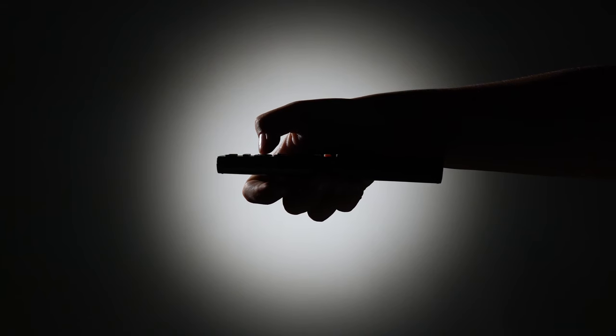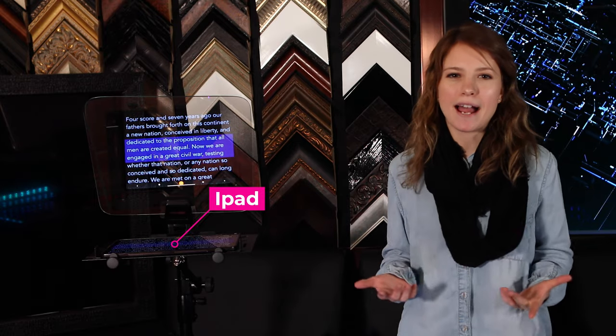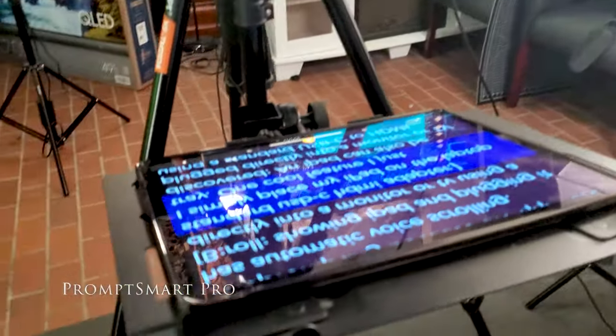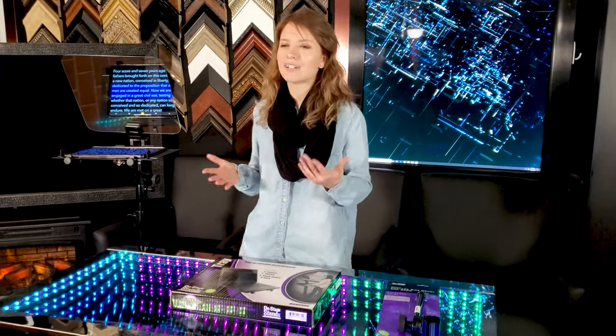Choosing your display: a Samsung TV, which has been mirror-flipped, makes a perfect display for a large-scale teleprompter. Simply press mute, 1, 8, 2, power to access the mirror mode from the hidden menu. We have another video dedicated just to flipping your screen — we'll post the link in the description below. I also like using an iPad for fast teleprompting because the app I use has automatic voice scrolling. One cool feature I just discovered: an iPad can also be plugged directly into a monitor or TV using a standard USB-C to HDMI adapter, providing easy viewability on a big screen while still being able to use my favorite teleprompting apps.